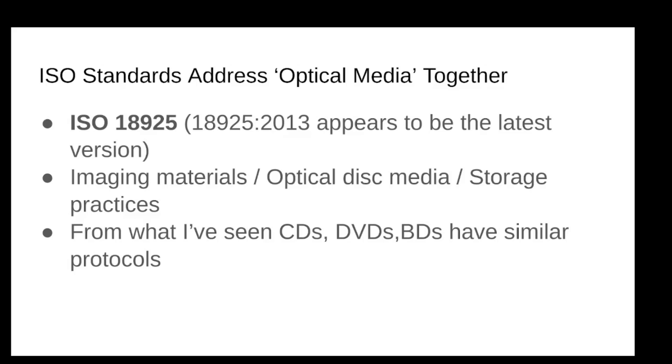We've talked in many videos about the different compositions possible with CDs — like Verbatim's product that uses gold for the archival grade. We also looked at how Blu-rays have been mostly HTL, using something called the metal ablative recording layer, or MABL, which is inorganic. So there is a difference in the composition of the recording layer. There are different dyes, and in the case of inorganic media like Blu-rays and M-disc, they're inorganic. So the recording layer is a bit different, but the surrounding materials may be fairly common. We never want the recording layer to be damaged by the elements.